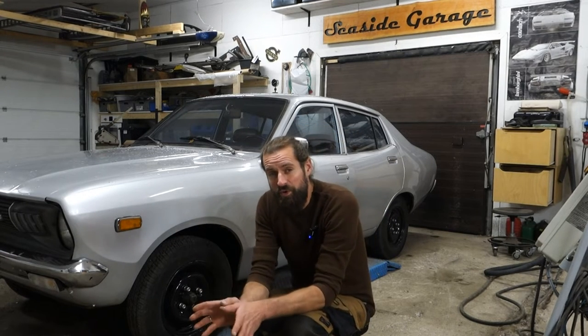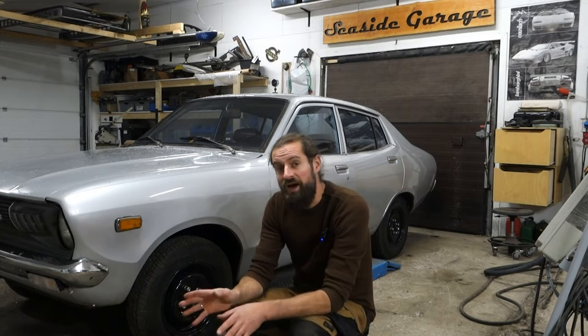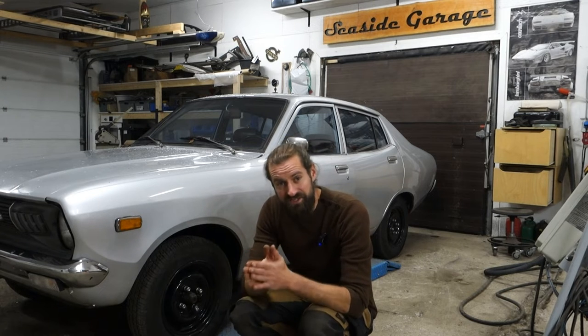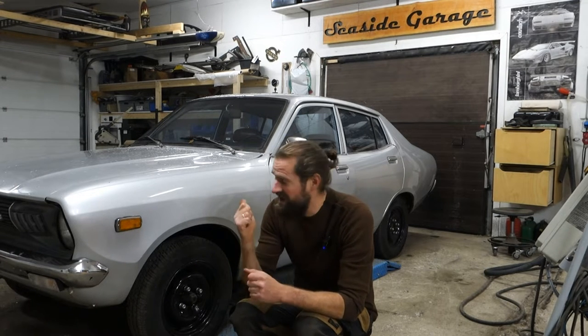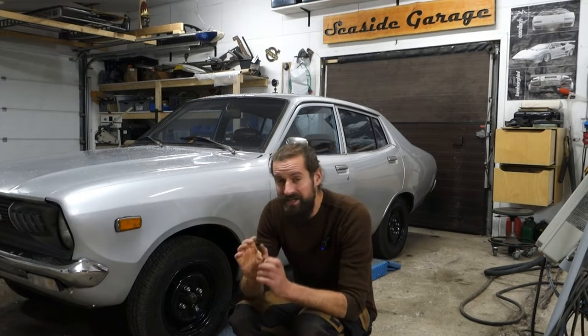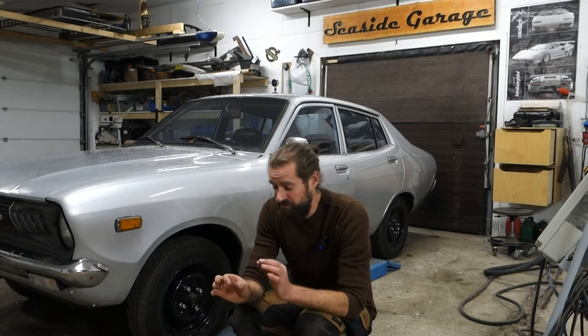This video was supposed to be a shopping list, finding out what I need to buy to make this car ready for the road. It shouldn't be much, but it's not going to be this time around because, as you can see, I have had an extremely hard time getting the car into the garage because it can fire up, but it doesn't want to accept any kind of throttle. It just dies instantly if I pull out the choke.